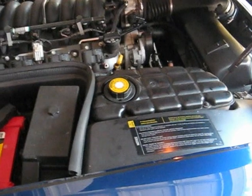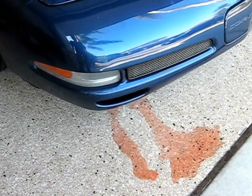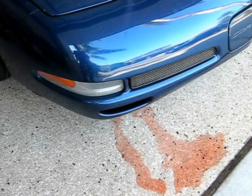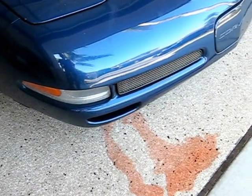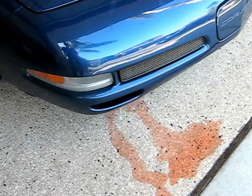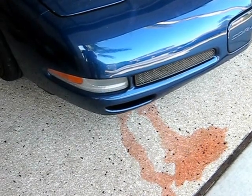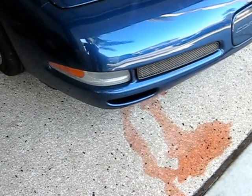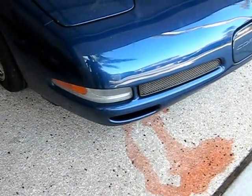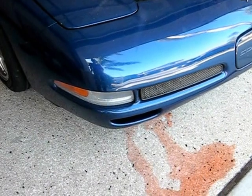We didn't get very far with filling up the fluid because I got a leak on that lower radiator hose, which honestly I'm not surprised about because it's got over 45,000 miles on it — it's a little on the soft side. I probably should have bought at least the two big hoses before I even started the job. I think the radiator went in okay, I just have to get a hose on the bottom and I'm going to put one on the top too. If you found any of this at all helpful, give me a thumbs up. If you want to see more, subscribe to my channel. Froggy out.